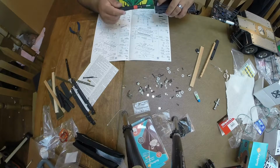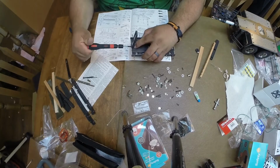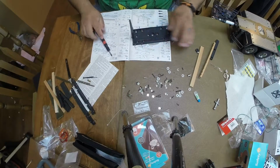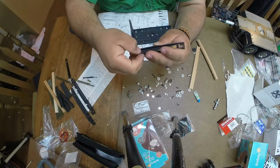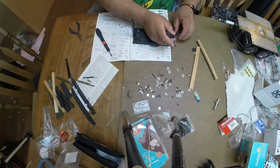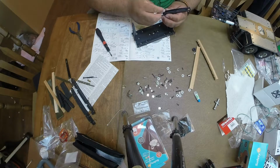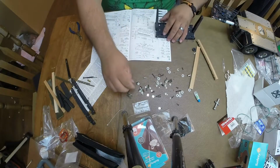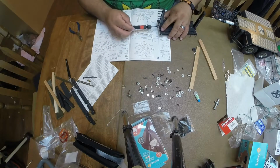And don't worry about it popping out, because the plastic sleeve that the lock nut goes in is designed to hold it so you can tighten it. I'll show you. So you can see it goes right here, and this guy just drops in, gets pushed in, and then gets dropped in like that. Except you gotta put your lock nut in right. Make sure when you're doing this your nylon's facing out. And we're putting in a MA9 again, which is a 3x10.